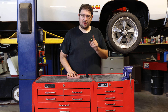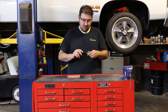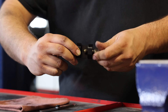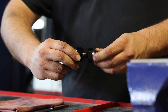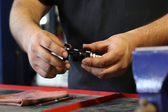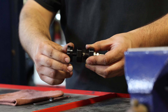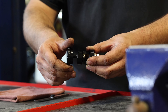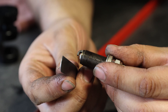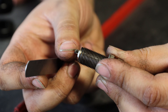Now that you've got the spark plug out of the cylinder head, we're going to show you how to gap it to the correct spark plug gap. First, we're going to use our Berger Motorsports spark plug gapping tool and insert and thread the spark plug into that fixture until it bottoms out all the way. Then you're going to slowly screw in the set screw until you just barely touch the ground strap here, and then slowly and incrementally turn in the set screw. This is barely going to take much, so as soon as you feel some resistance, go just past that point, back off, and check your measurement. This is the 22 thousandths of an inch feeler gauge for spark plugs just gapped to 22 thousandths.